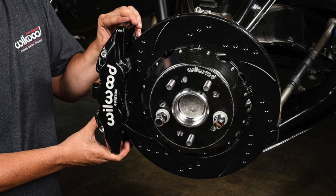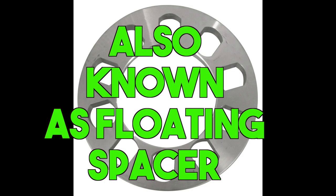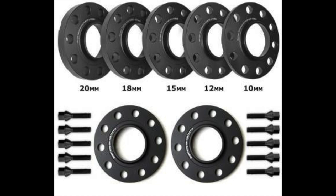There are two kinds of spacers. Some are just the metal plate — the caution with this type is it's not hub-centric, so it's not going to center your wheel; you'll have a lug-centric fit. Also be aware that if the spacer is too thick, you might need longer studs to make it fit right. You do not want short studs because you will lose your wheels. Some spacers actually have studs built in. European cars wouldn't have studs because they use lug bolts, not lug nuts.